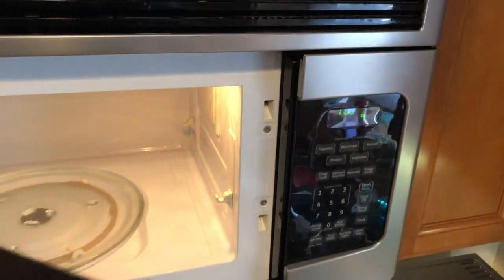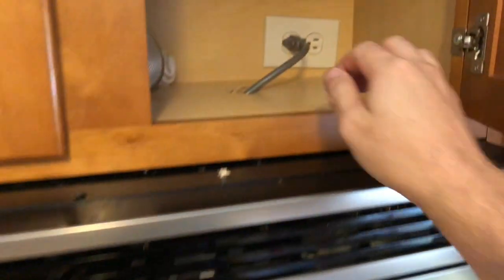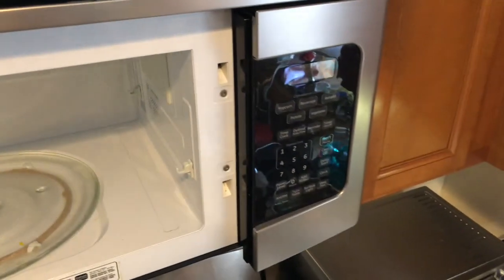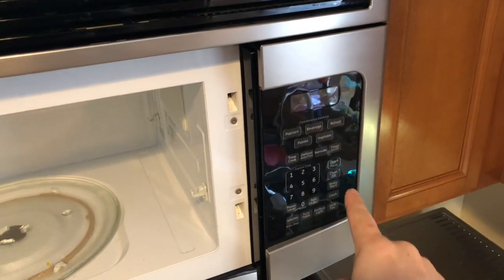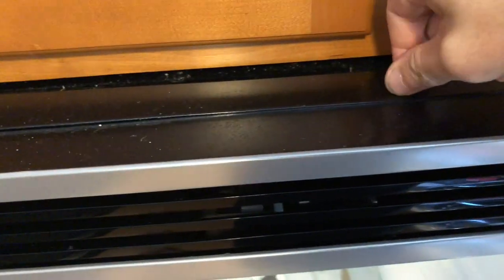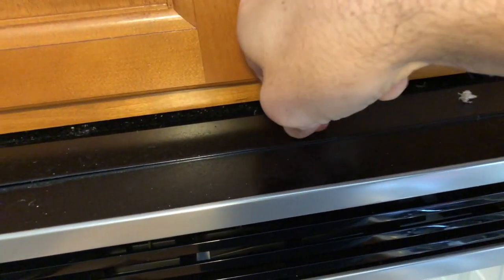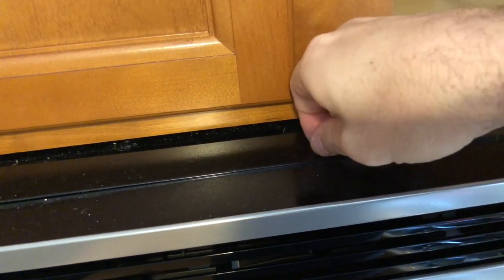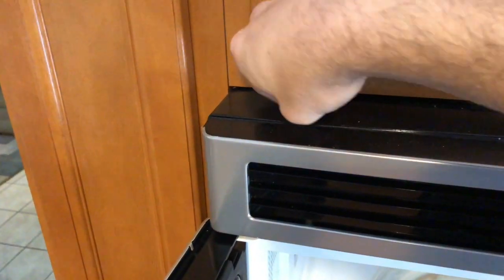First of all, always disconnect the power before opening up your microwave. What's happening is inside, the ribbon is not making a good connection. Normally what you have here is these screws. There are 1, 2, as you can see mine weren't in very well because we had a recent issue with this thing, because we hooked it up wrong with the power going to it. And 3.